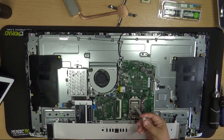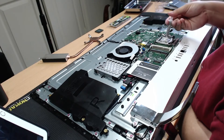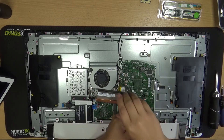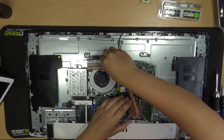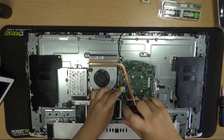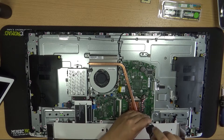Next, apply your thermal paste however you like, as long as you're making sure there will be enough to completely cover the CPU's IHS. I'm using some old Cooler Master paste. Now we can replace the cooling system, making sure to evenly apply pressure with the four CPU socket screws, tightening them in a diagonal pattern. Don't forget to add that fifth screw back to secure the fins.